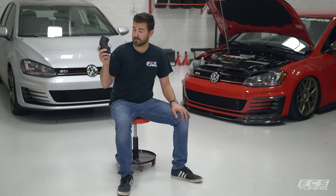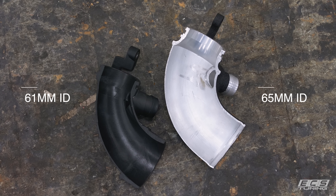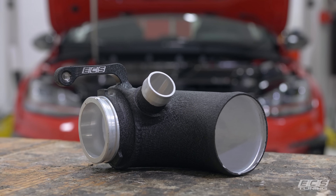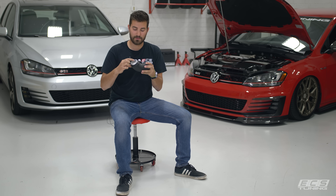This is a quick to install and affordable little mod that really lets your turbo breathe more thanks to its larger diameter. We made it with a 70 millimeter OD thin wall 6061 aluminum. You can see it's wrinkle black powder coated, and at this end we've got it bead rolled so your hose clamp stays clamped in place.